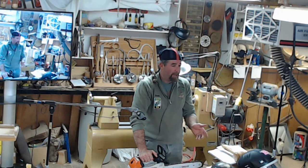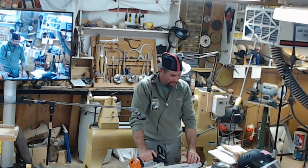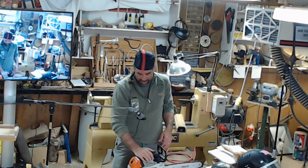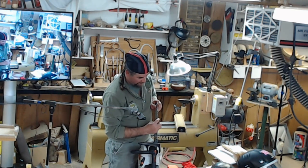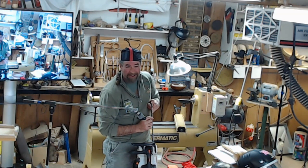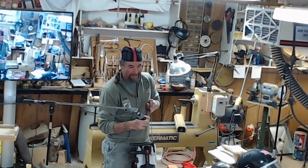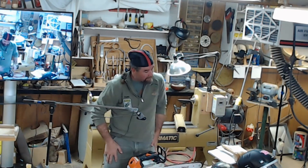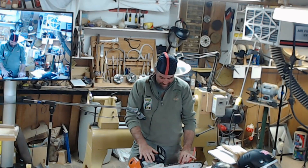On softwood, pines, poplar, stuff like that, go with the chip and just rip it through. Or you just go with a semi-chisel and it'll do basically everything. So I usually keep mine at a 30-degree angle and keep them sharp. The biggest thing is making sure that this point here is sharp. All it takes is one rock, one piece of dirt, and that curls that thing up, and then your saw is not cutting like it should be. Very bad.